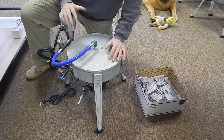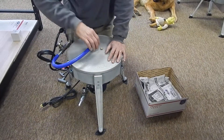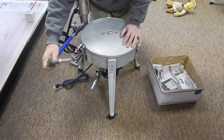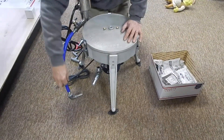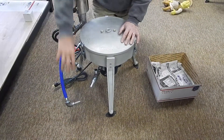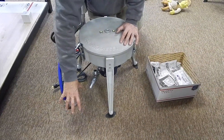You'll know it's done because your braided hose — you'll see that it's not running. I'm going to pull this out; that's the supply to it. Realize there's going to be residual oil in this, so when this is laying down you're going to want a container under it.